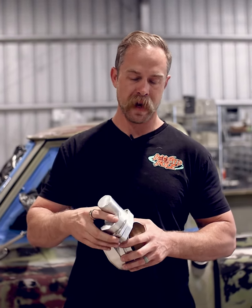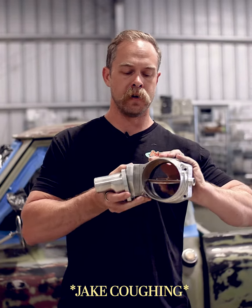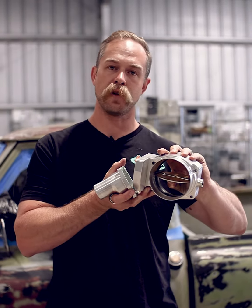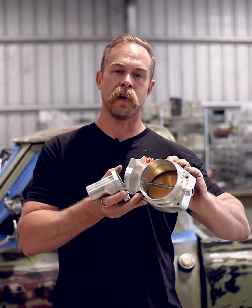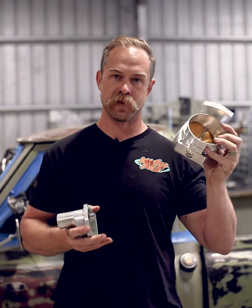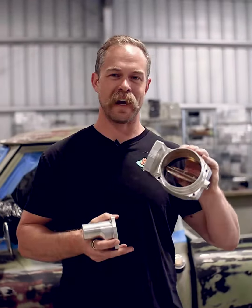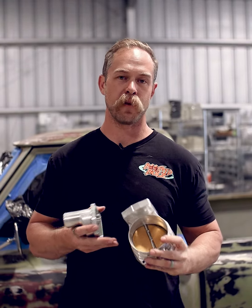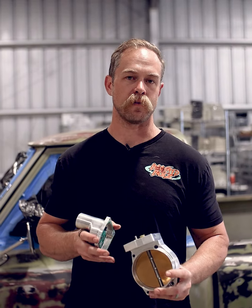Also, some may have that same sensor, but true 100% range of motion is not possible in any of these. They usually go to about 82% to 85% depending on the make and model of the throttle body. If you have one that goes to 85% like ours, but your ECU sees wide open throttle at 82%, you will get an error code the first time you go wide open throttle.